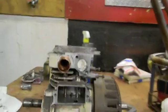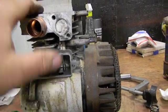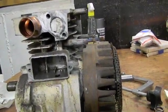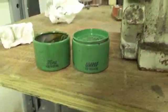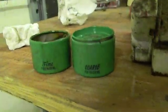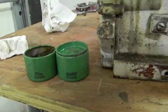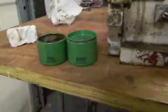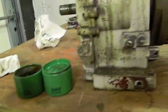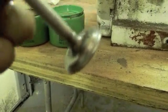We're back out here working. I was asked to check these valves to see if they were bent. I didn't do these doors yet — I started working on the intake. I have some valve grinding compound here, coarse and fine, thanks to VW Richie who came in with this stuff years ago. We don't really use valve grinding compound at work — when the seats and valves come in we just put it together. I checked them and we seem to be good. Put a little dot of the fine on there, ran it around, and as you can see it's a perfect seat on it.